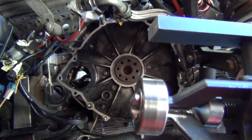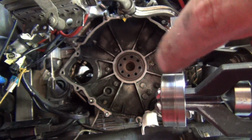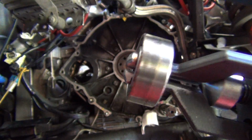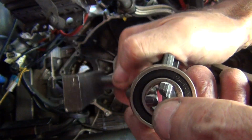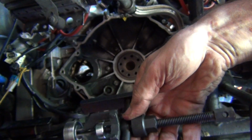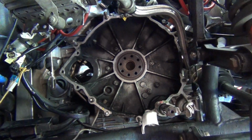If I can put that in shot, you can see there the different colour on the bearing, which side sits out, which side sits in. So it sits in that side just a little bit deeper than what it sits out. So it's a good guide anyway to make sure. I had to grind down my puller a little bit. These bits here, I had to grind them down a little bit to get them inside this bearing, just with a hand file, but it worked, and this bearing puller worked really well once I worked out how to use it. Anyway, next step. See you soon.